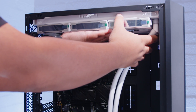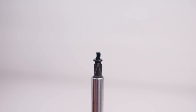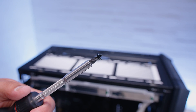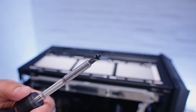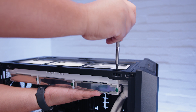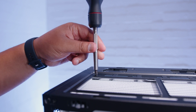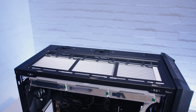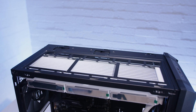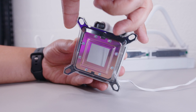Once you've aligned the radiator, hold it with your hand and locate the 12 screws that come with the cooler. Optionally, washers are also included — it depends on your case and the size of the cutouts. Fasten one corner first, then fasten the one diagonally on the opposite end so the cooler is held in place. Then get the rest of the screws and washers and rinse and repeat until all 12 screws are installed.